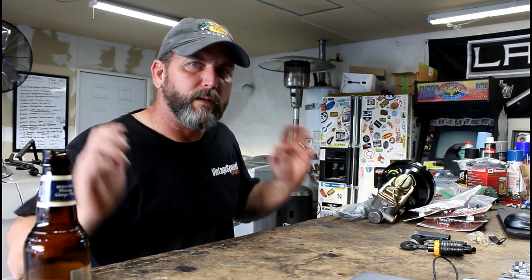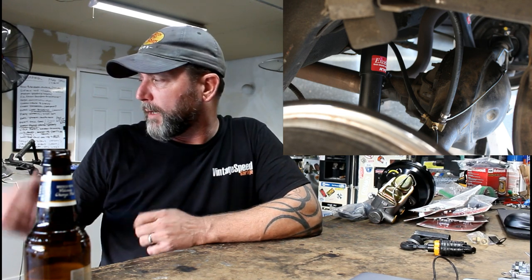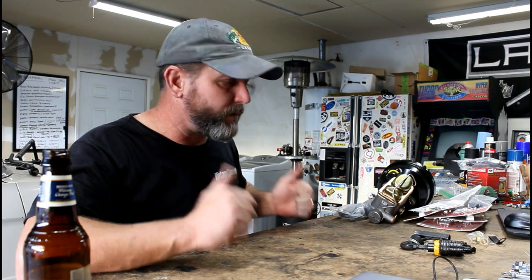Well guys, it's been a productive weekend here at the Vintage Speed Garage. This weekend we replaced all of the rear brake components, rear suspension bushings, and rear shocks on our 66 Mustang project. Now we've got polyurethane bushings front and rear in the shackles and leaf springs, ready to go. We've got all new brake components — all the hardware, brake shoes, wheel cylinders — swapped out on both sides. We've got the vent line in place, new hard lines, new flexible lines, so all of that's taken care of. Our brake system is closed up — now all we have to do is swap in our power brake booster and master cylinder into the front engine compartment and the brake system will be done. We'll have disc brakes in the front, drums in the back, with a proper disc-drum proportioning valve.